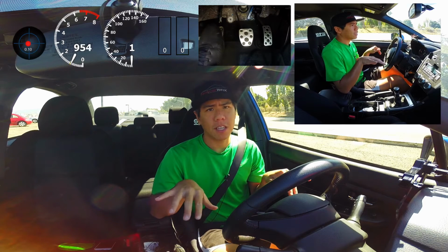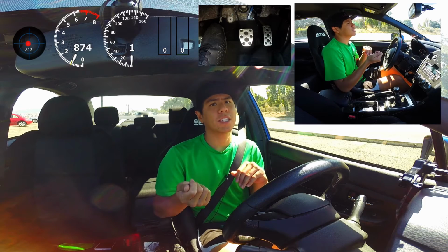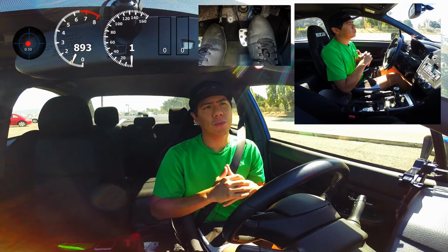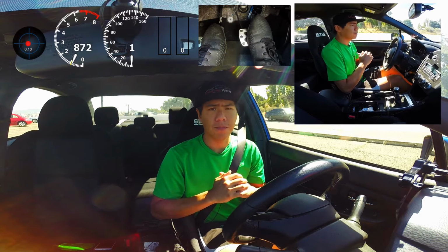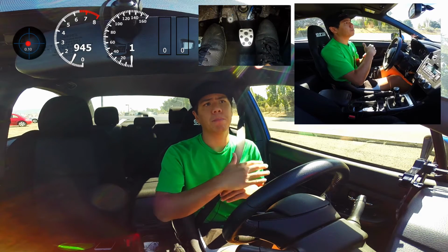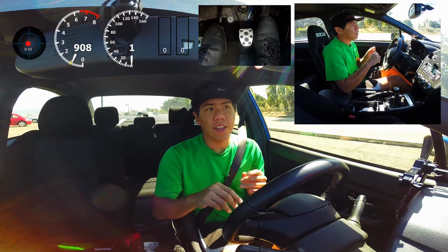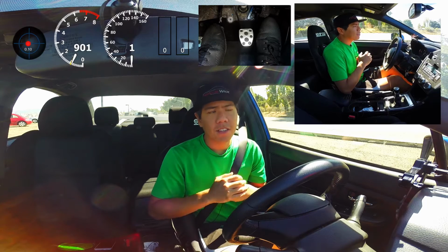You might step in on the clutch. So step on the clutch, slide the gear out, shift into the next gear, and then, this is the heel part of it, you want to blip the throttle with your heel and bring the throttle up, because as you downshift into the next gear, it's going to bump the engine RPM back up. And then slowly let the clutch out, right? Or let the clutch out and then get back on the gas.